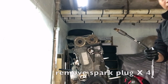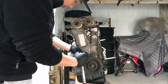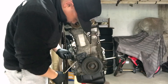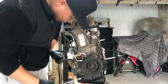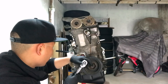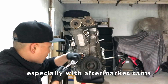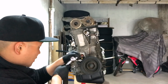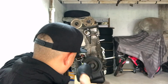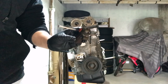You also want to make sure you take out the spark plugs. Removing the timing chain tensioner and the timing chain tensioner cover. These timing chain tensioners are very easy to go bad — that's why they made that little door, so you can replace it easily.